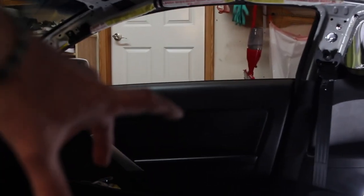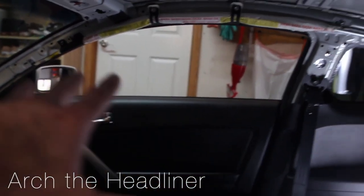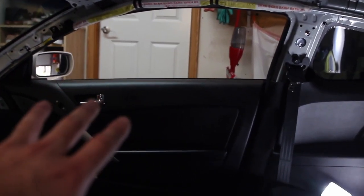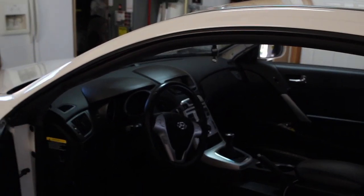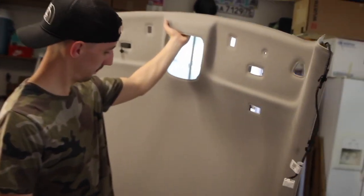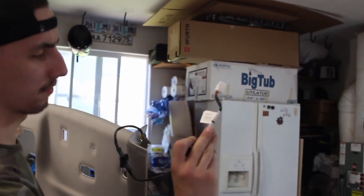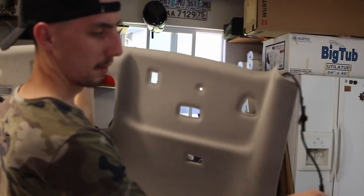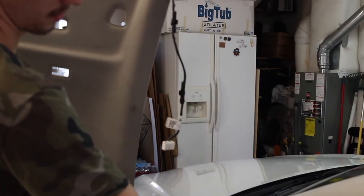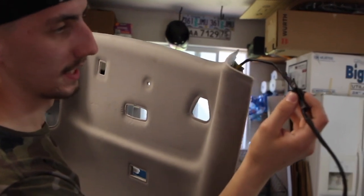Once you have all those clips popped out, take the front end and the rear end, flip it sideways, and make a rainbow or half-circle shape out of it. Try not to bend it too much — just wiggle your way out from whichever side has more room, and you've got it. No creases, nothing. There's a wire on the driver's side along the pillar — it's either for the microphone or the light. You just need to unhook it; there are little clamps you pop out.